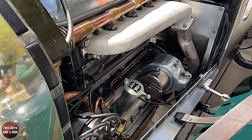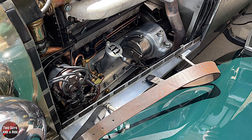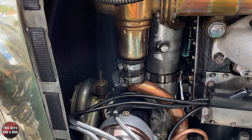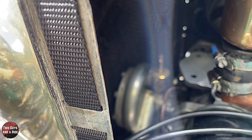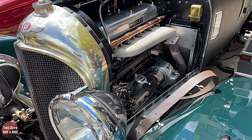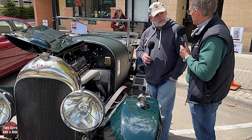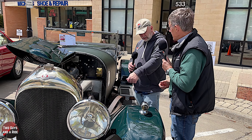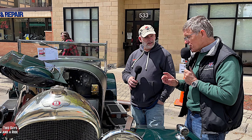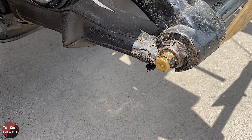There are no filters on this car. I have to say I'm embarrassed because I come from the filtration industry - there's not one filter here. The water pump is at the front and there's a little brass T-handle on the top. Periodically you tighten that and it squeezes a little grease down into the water pump bearing - I do that about every second or third outing. It takes a very creamy zinc-based grease. There are 64 grease nipples on the car - each one of these hexagonal unions is effectively a grease nipple. You can see them all over the car.